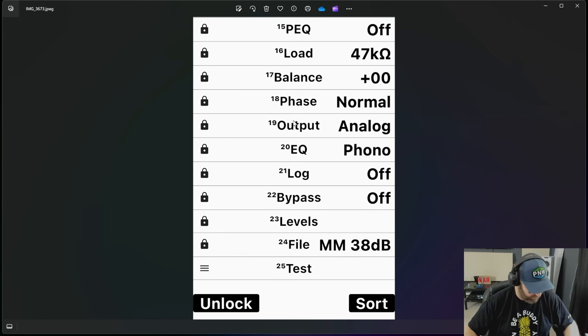For your output, you can pick different outputs. If you're going to use an external DAC, you click it open — I've got it set to analog since I'm using the analog outs, but you can switch to digital. The digital output caps at 24/48 or 24/96. For the EQ curves, for most vinyl users 'phono' will be the only setting ever used. For CD or digital music it should be set to line-in for flat response. You can also handle older 78s.